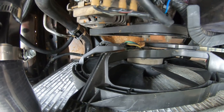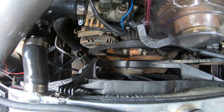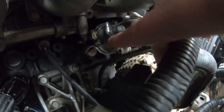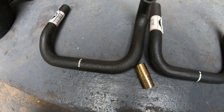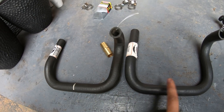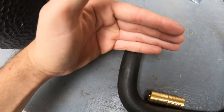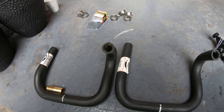This thermo looks like it hits the harmonic balancer on camera, but it actually clears it a lot. There's a port there and another port right there. To get to those two ports, we have to custom fit these coolant hoses right here. I'm going to chop it right here and here, chuck this joiner in between so it becomes one long hose — it has to be about 45 centimeters in length. Then we'll trim it here and it should go into those ports perfectly.